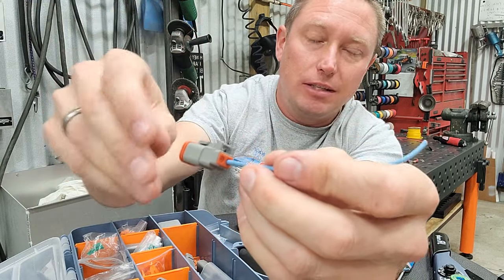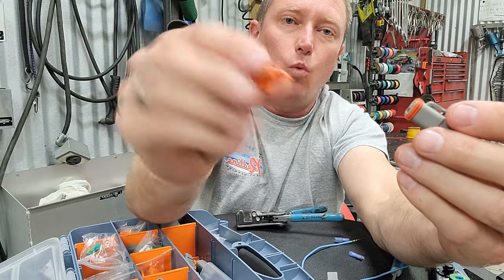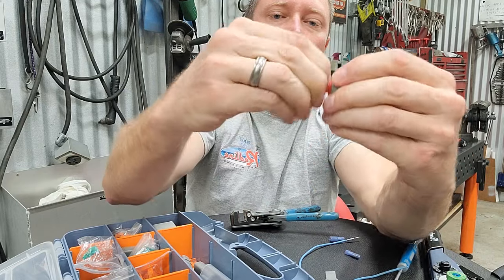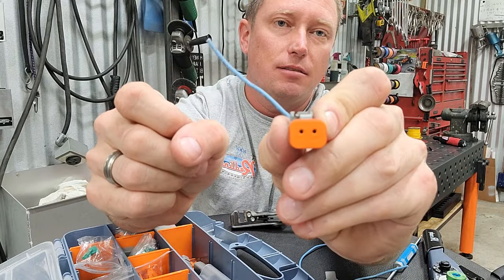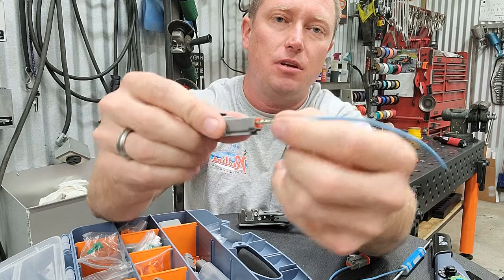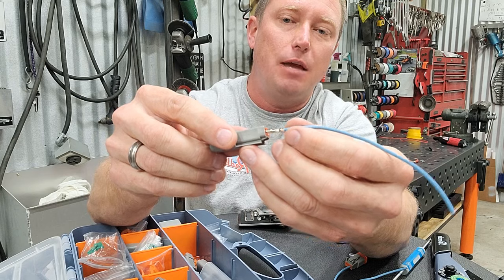I'm not going to put the second wire in because it's not necessary for this demonstration. Once you've got your female terminal up in there, you're going to take your wedge — it looks like that right there — and you slide it right into the end of it and wiggle it around a little bit until it goes in and snaps into place. Here we have our male housing right there — same kind of deal, you just insert it right in there. I recommend making sure when you insert this stuff into these connectors, hold it from up close. Don't hold it from way back here — you can just completely jackknife that wire to the side and do damage to it.